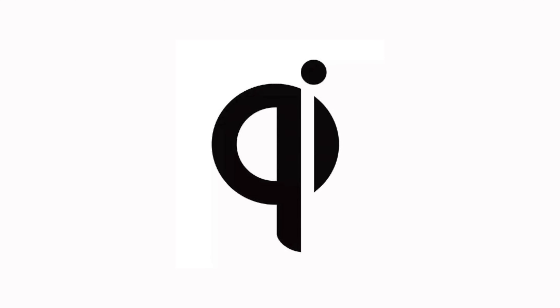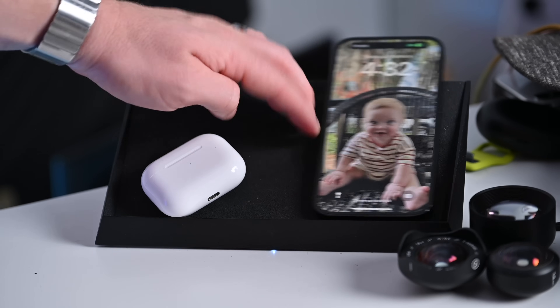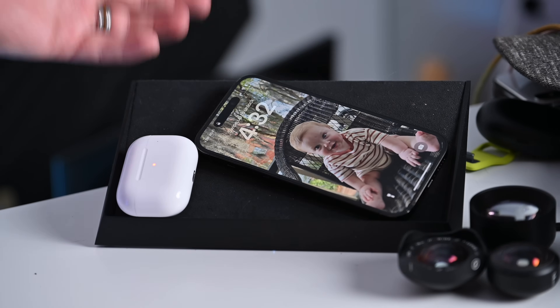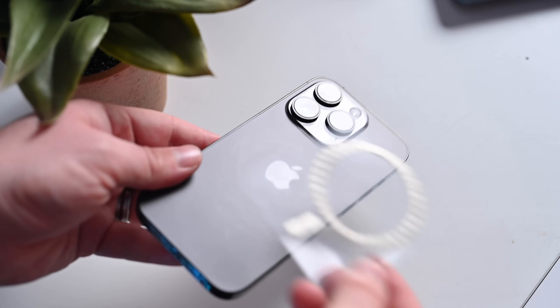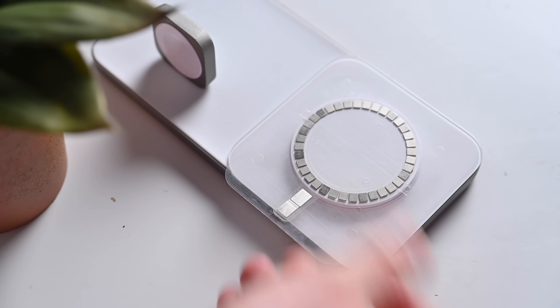Qi is the most ubiquitous form of wireless charging. You've probably seen tons of wireless charging pads around. This one here is from Nomad, and here's a nice one on my desk from Tesla, where you can place your phone anywhere on it. There's honestly no shortage of Qi chargers available on the market. Apple's MagSafe, on the other hand, is a little bit different. It's still a wireless charging protocol, but it also involves a ring of magnets around the actual charging coil. This helps with alignment — you can properly align your phone so it connects to the charger and it's perfectly centered. With Qi, if your phone is off even a little bit from the center, you can have drastically slower charging speeds and you could never even know. MagSafe helps alleviate those issues.